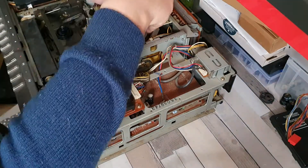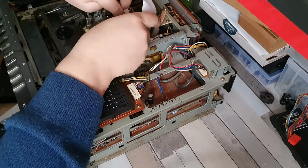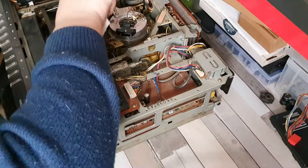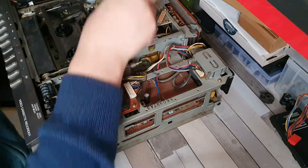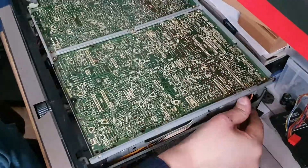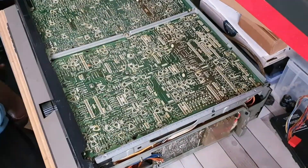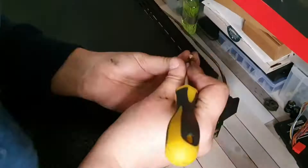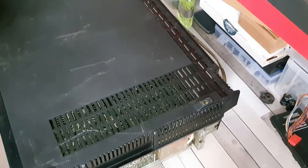Things are not perfect because I do need that flat belt, and I also think the set I was using — because it is a 1976 set — probably didn't sort out the image properly on fast forward and rewind. That's just something to bear in mind when you're viewing it and testing the unit. I will need to possibly test it on a newer set over composite, which I'll try next time.